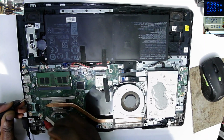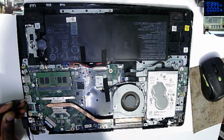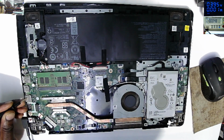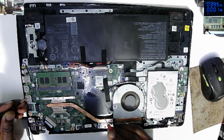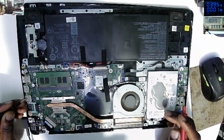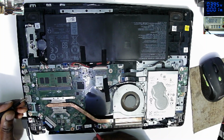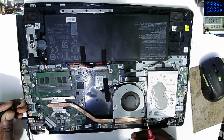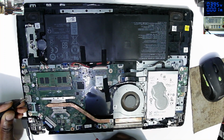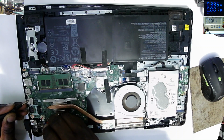is 19 volts. And I can see a big power rail, which is going to the plus 19 volts, which is going straight to the screen. You know how the screen is working. We do have 19 volts for the backlights, which is boosted after the inverter chip. And we have 3.3, the power on signal, and 3.3 to adjust brightness. The one is to power on the screen, the one is to adjust brightness. I think I explained how these signals are working. So on this side, we do have 19. On the other side, we have 0.